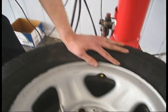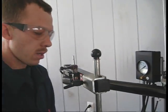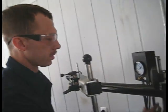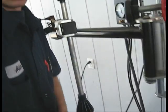Now this is a customer spare tire, and it has tire monitors in it. Always put in more air than you normally would, because how often do people check their spare tires? Not very often. On this car, average, I'd say you put 35 in it. I'd put 40 in it, because the person's never going to check it, and it's not fun to have two flat tires when you're on the side of the road. Good point. So if it's a spare, you put more air in it than you would if it was going on the ground.